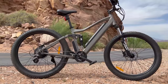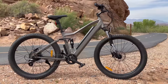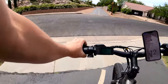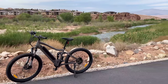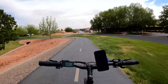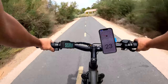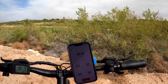Let me talk a little bit about geometry. This is definitely a mountain bike — it's got a huge wheelbase of 46 inches and a standover height of 30 inches, kind of a mid-step design. I'm 5'11" and I can stand over it with about six or seven inches to spare. You're positioned like a typical mountain bike with a hunched-over, forward lean, which lowers your center of gravity for better stability. The reach is 22.4 inches — a very spacious bike with plenty of room. It's well balanced; I could easily ride it without hands. I've hit 25 mph down a smaller hill and it just glided with no shaking, wobbling, or death wobble. At roughly two battery bars gone I've done 9.37 miles with a mix of throttle and pedal assist.